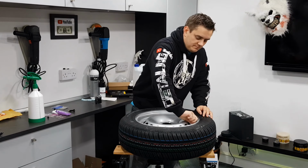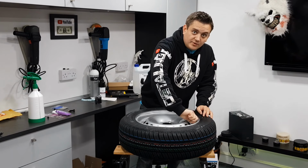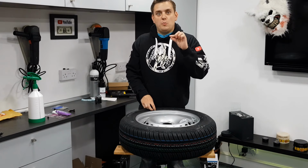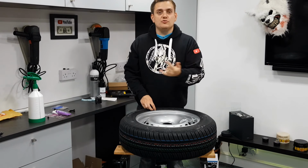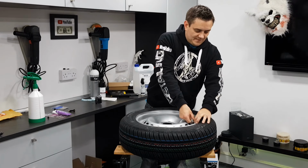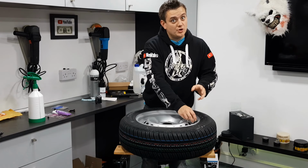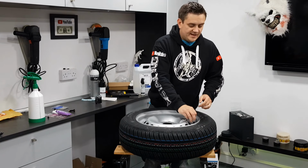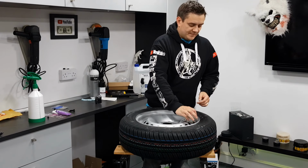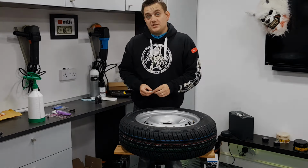you'll hear it go. So be careful here because you don't want to split the valve. But if you keep twisting it like that, what I actually found on the truck was that the corrosion, the actual paint material, was moved during this process, and it allowed the seal to sit good again. Obviously with a little bit of soapy water I could keep twisting it until I saw that the soapy water was no longer bubbling, and that fixed that. That only did fix it on one of the two remaining wheels though. And that is fix 3.